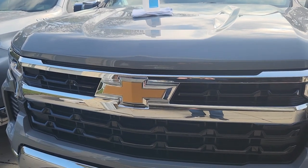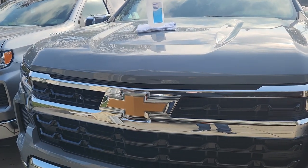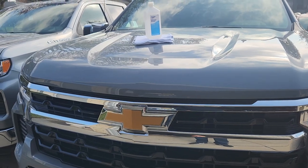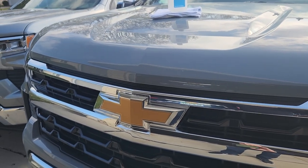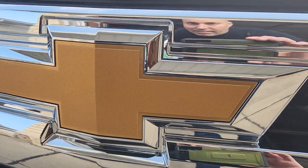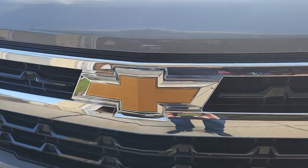I'm not going to do this in real time — I'm going to pause it along the way. The first thing I'm going to suggest is, like anything if you're painting it, even with PlastiDip, make sure you clean that surface thoroughly. I'm just going to use some rubbing alcohol for this. Don't go too heavy, because I've done that in the past and let alcohol settle between the gold and the chrome, and that's caused problems.